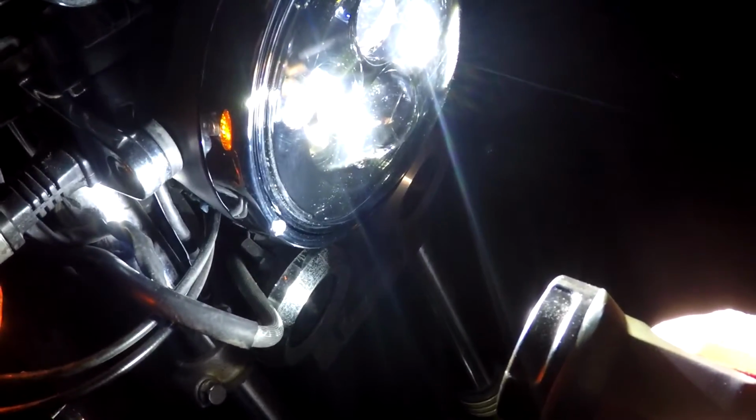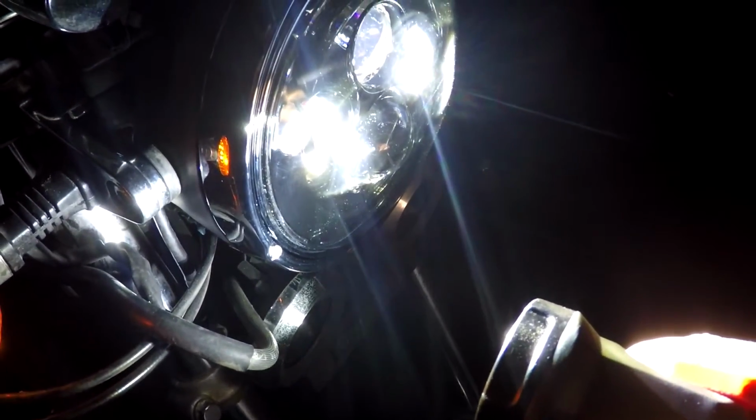If for some reason you're not satisfied with the height, you can actually put your hand on the housing itself and manually adjust it. And it should stay in place. Those rubber stoppers will kind of keep it in place. So it just takes a manual adjustment there to see. And if you notice that the sharper, thicker part of the light that you see here isn't centered, you can see that screw right here, you can adjust that with a screwdriver and change the angle of it like we talked about earlier.